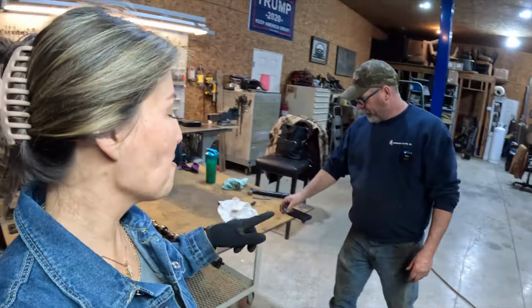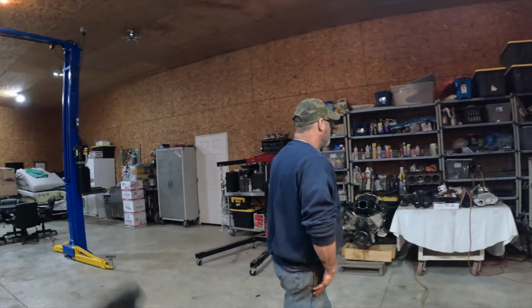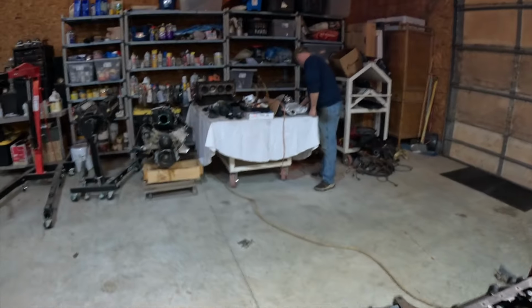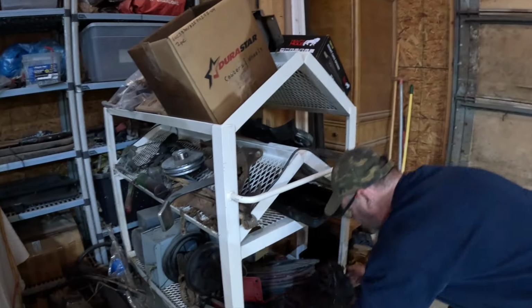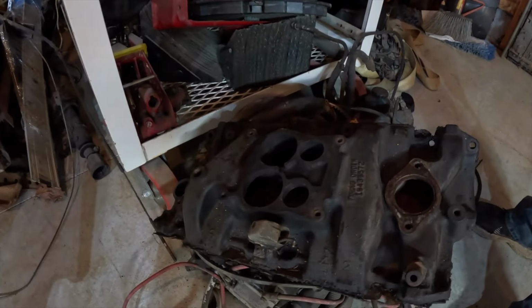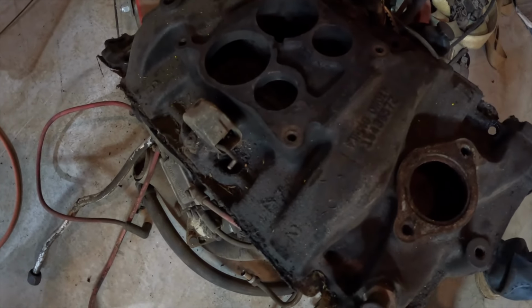Kent actually knows the firing order of the pistons. Yeah, most people do. It's on the intake. Tell us, what is it? And is that the same for all 350 engines? Yes. I was looking for your intake. Right here is your intake. Firing order 18436572. Yeah, but you knew that before you saw that. Well, that's because I've memorized that number. I've messed with them a lot.